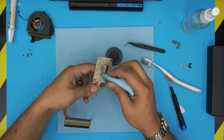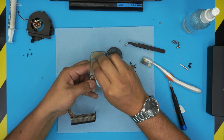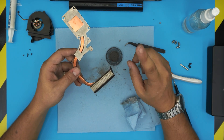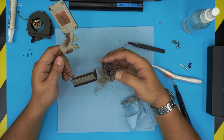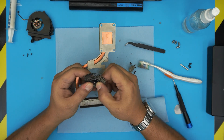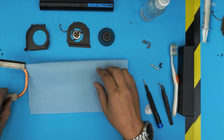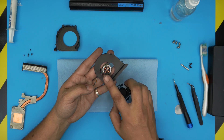Clean the heat sink nicely too — use a toothbrush and rub it in. I recommend grabbing an air compressor rather than air cans; I'll leave a link in the description. Air compressors are really handy and powerful, and they blow dry air unlike the canned air. Take everything outside and blow out the dust, and clean the bottom cover as well. Once done, the heat sink and fan are cleaned and the lubricant has been added to the motor.